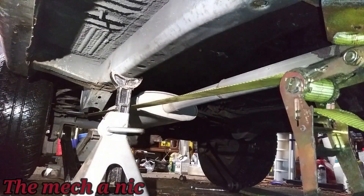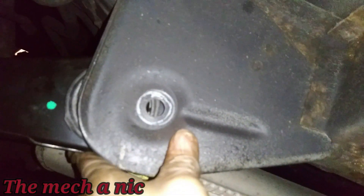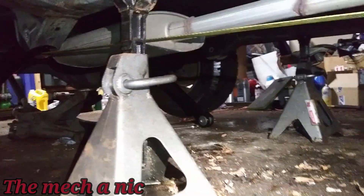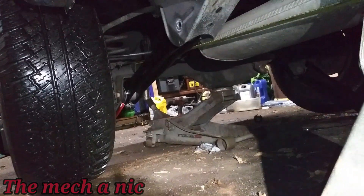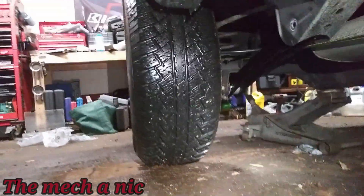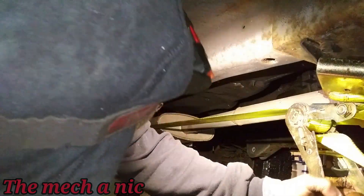Come on! Let's go over there and see if it made any progress bringing it forward. Still have a lot more to go. It's definitely coming forward but it's going to put up a fight. Slightly new plan — I got both sides of the truck on jack stands and the rear differential lifted just barely off the ground with the floor jack in the center. Now everything is off the ground, and hopefully without that extra weight the ratcheting strap can do its job and start pulling it in.